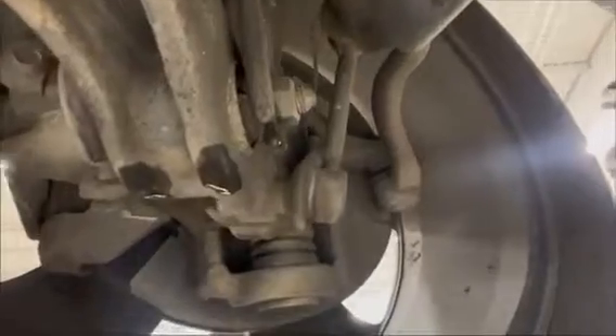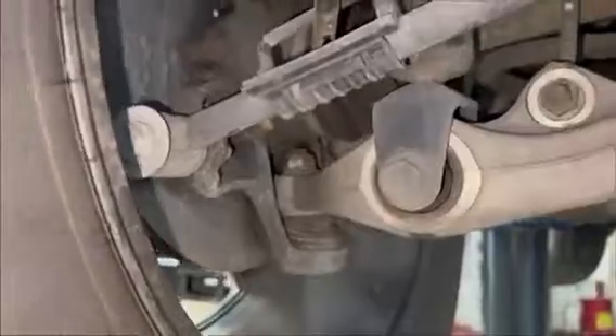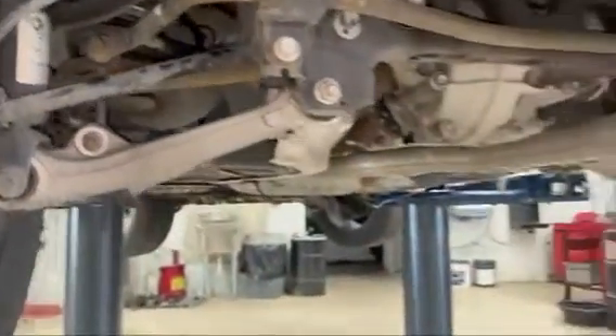As far as your creaking or popping noise over bumps, I didn't find anything wrong with any of the suspension components. All of the boots and joints have zero play or tears in them. The rears are also in good shape — no leakage from any shocks, no excessive play. Oddly enough, the noise seems to be coming from this rear door hinge. It makes a noise when you open and close it as well as going over bumps. I was able to pinpoint it during a test drive.